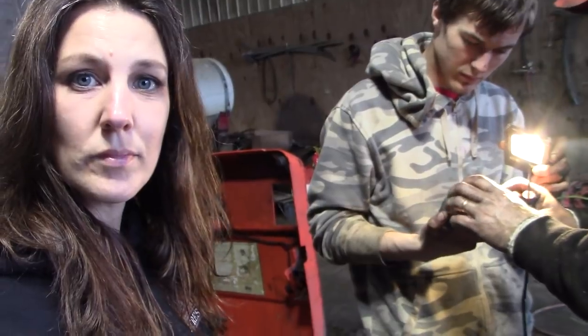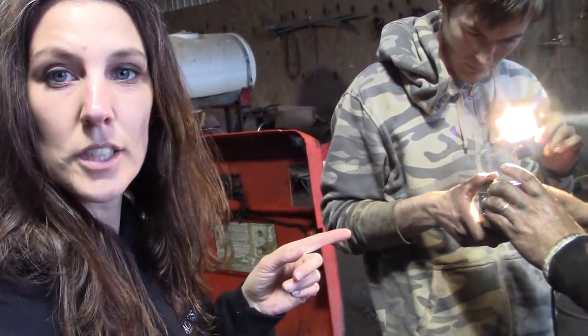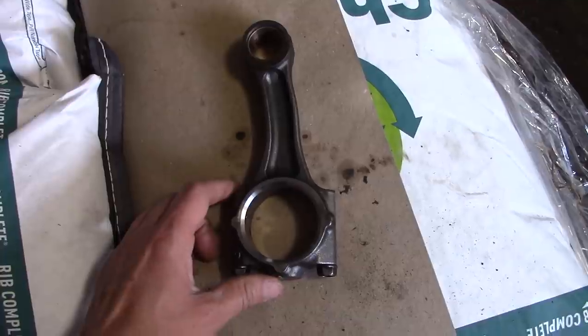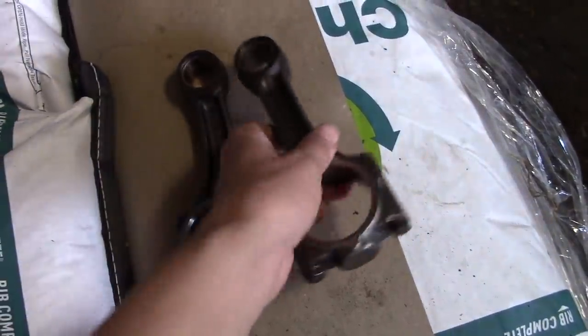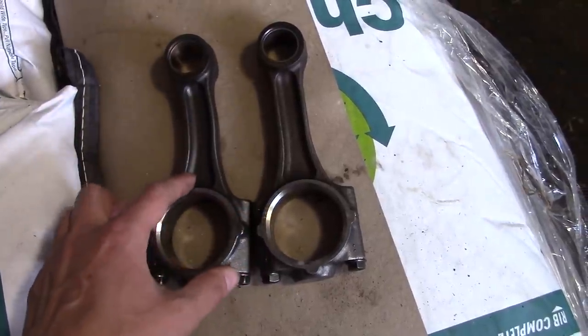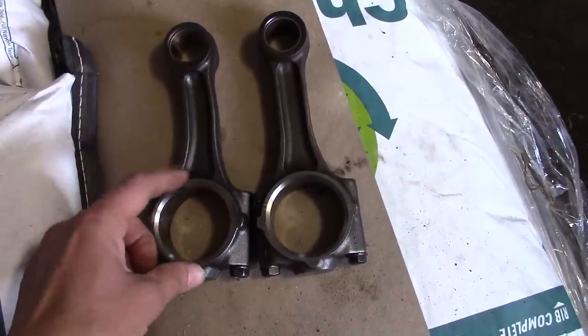I think we'll be back tomorrow. We're going to let this thing soak overnight in some degreaser, and then tomorrow they'll put it all back together. So this is part one of the continuation. After doing a little bit of digging, the guys found that this connecting rod is bent. We ordered another one, which is right here. You can see this is bent. When the oil went into the piston, it was too much compression and something had to give — and it was this rod.